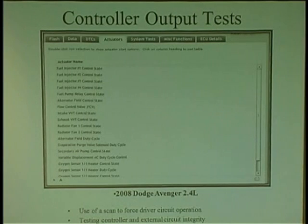I'll give you an example. I had an air pump code. It said air pump circuit fault. So I get on there. I go like this. Boom. Nothing wrong with that. Did it again. So the computer is grounding the relay. The relay is engaging the contacts. The pump runs. It's got to be an ECM. What else would you do? Keep setting an air pump circuit fault.